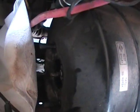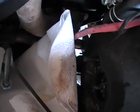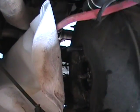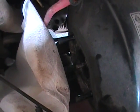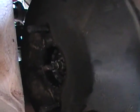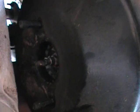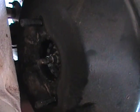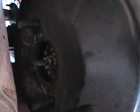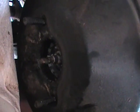As you can see, we got it off. As a matter of advice — brake fluid loves to eat paint. When you are taking something apart like this that is going to leak, and I guarantee you it will, put something underneath the master cylinder to catch that stuff. That just saves you from having to go back and fix paint later on. You can see along the bottom of the brake booster all that slime — that is the brake fluid eating the paint. That gives you an idea of how significant the leak is.